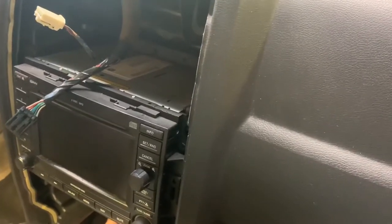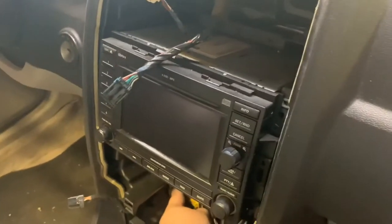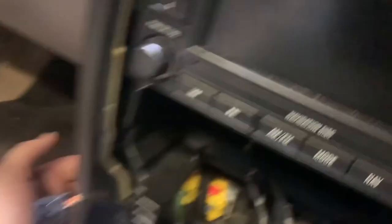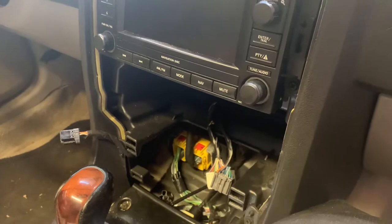Now deep in there is our SRS module. I'm going to plug it in and show y'all what we look like after. I just wanted to capture this clip of the last plug - pray for me that I don't have to pull this guy out of here. There we go - clipped in. You can see the wiring there. This module has a rubber dust boot over it and there are four bolts that hold the module in place. To get that module out it's way down in there - way up into the dash. Like I said, you would have to disassemble the entire dash and pull it completely out of the car, which is absolutely horrible because this is all one piece.